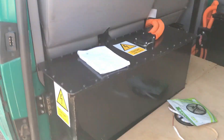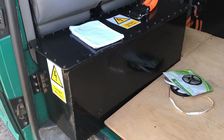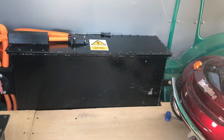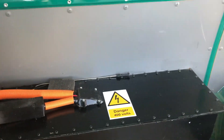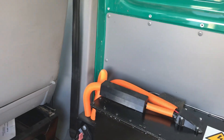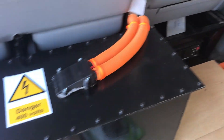In the back of the van, we've got the battery set up in two modules — that's one of them, and over the other side we've got the other. So you've got 200 volts on one side, 200 volts on the other, and of course they are linked in series. So you've got cell one over here, and then it goes all the way to the end cell, then the next first cell, and the last cell is over here. I've put some stickers on it just to warn people — obviously there's only 200 volts in each one, but there would be 400 volts across this one.